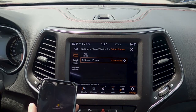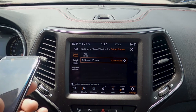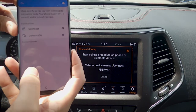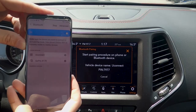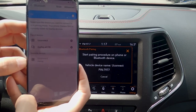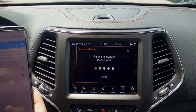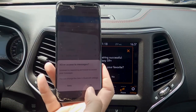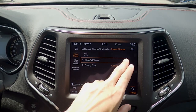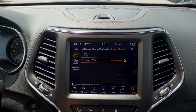Setting up an Android device is literally the exact same process. On your phone, go into your Bluetooth settings. We're just going to scan for active devices after hitting add device, and wait for Uconnect to show up under available devices. There we go — Uconnect is there, so we connect in. Same thing: make sure the pin numbers are correct, yes and yes. Do we want to make it the favorite phone? But first, we want to allow access to our messages, allow access to our contacts, and set that favorite phone yes or no. We do have the option of setting a favorite phone. We can easily delete a phone if we need to — just delete phone. And it's strictly the Galaxy that's connected there.